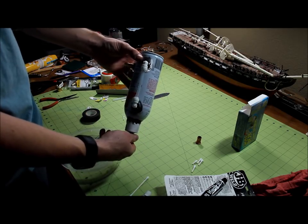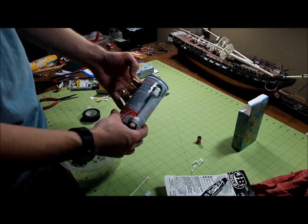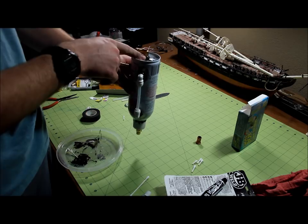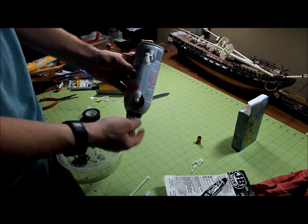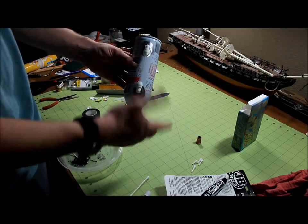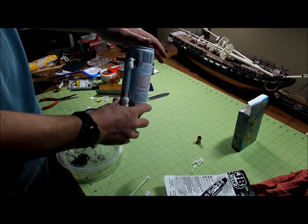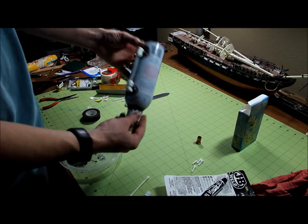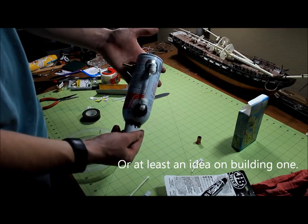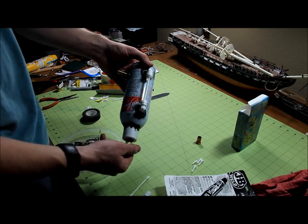I know I didn't go through every step, but I explained the concept — it's your choice where to place the fittings. Just cut a couple holes, stick them in, JB weld them on, and modify that copper stub out — put some holes in it to let air vent through along with the moisture coming out through the valve cover. Hopefully that's what you were looking for. If you have any questions or comments, post them and I will follow up with an install video later.